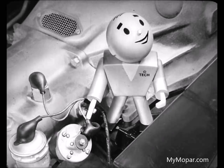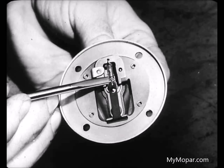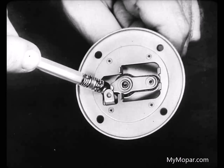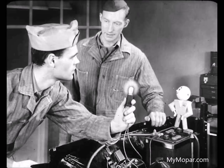So we tape up the wire and fix it so it can't rub against the frame again. Better show Don how to clean up those governor points in case they'd been sticking. Sure, we'll take the cover off and clean these anyway. The governor points ought to be clean because condensation can cause corrosion and you'll have poor contact. First, we take the movable contact arm off the cover. Now we can clean up the contact on the arm with a clean cloth, then clean the stationary contact with a piece of cloth on the end of a pencil or with the eraser.